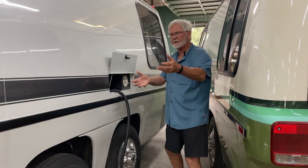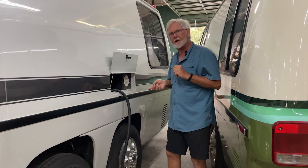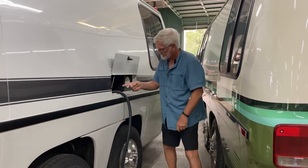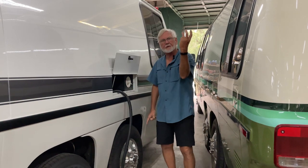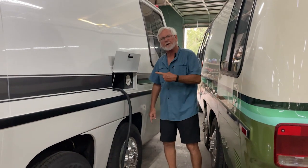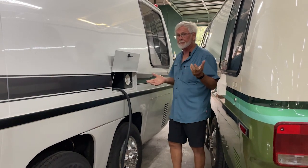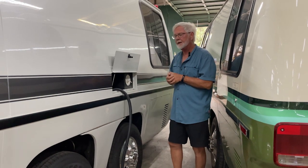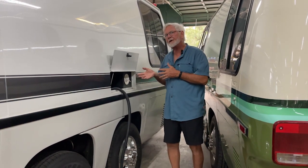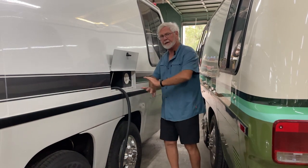So when you're going to leave, you take the cord, you roll it up in that compartment — and some of you guys in cold areas know that's sometimes not easy to do. You coil it up, then take that 50 amp plug on the end of the cord and plug it into that receptacle. Why? Because the cord goes to the circuit box, and that receptacle goes to the generator, and if you plug into that, the generator can feed the circuit box. Now, Royales and some other coaches over 45 years could have had an electric transfer switch added — it's an improvement until you don't know it's there. That's why you need to know what's in there. GM kind of used the KISS system: coil it up, plug it in, and she's done.